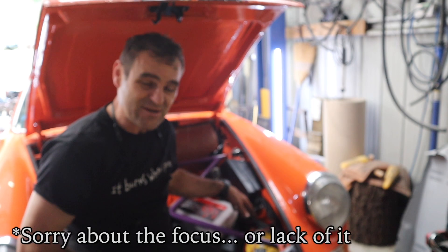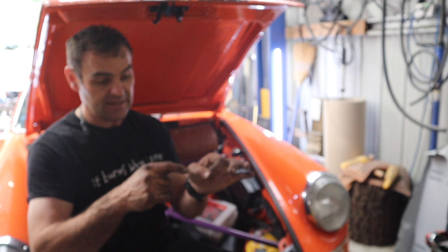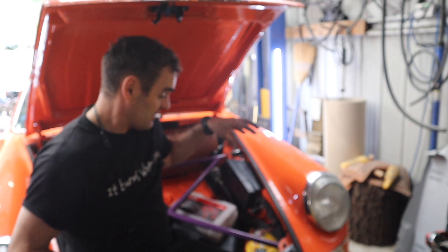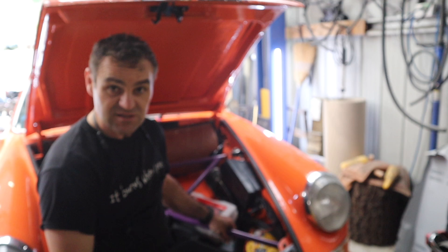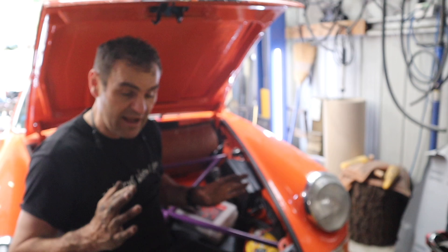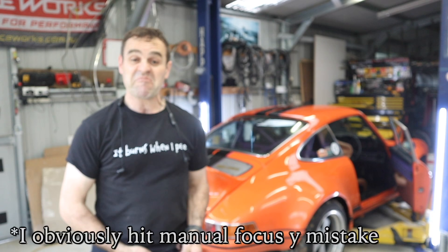After a bit of playing around, I have new battery terminals and everything's reconnected, sitting a lot nicer than before. What actually happened down here is it cooked the terminal of the battery itself quite a bit - there was corrosion and erosion where it got so hot it affected the soft lead metal on top of the battery. I've cleaned that up, clamped it well with new terminals that are nice and tight. Fingers crossed - I'm going to start it up now and it all should run nicely.